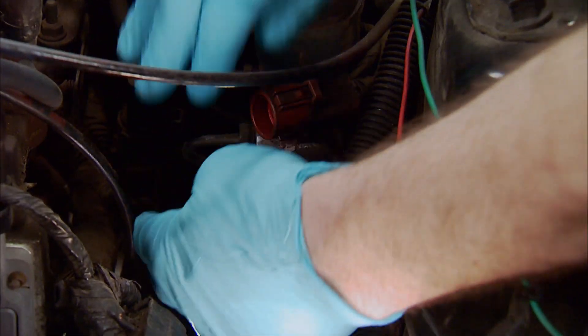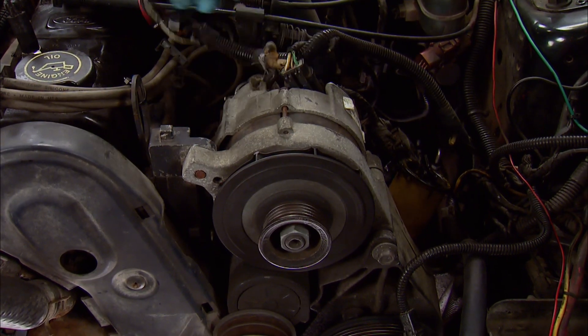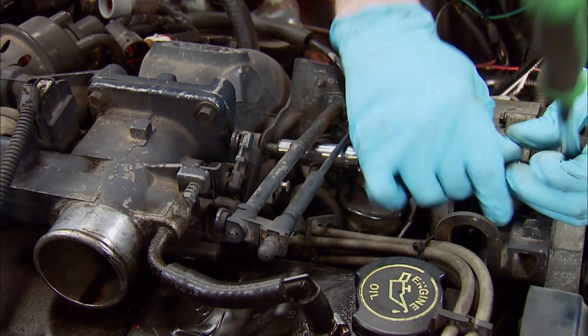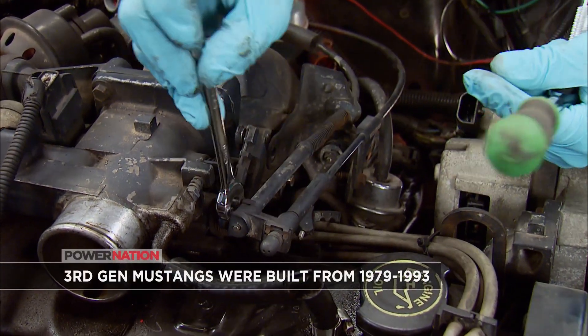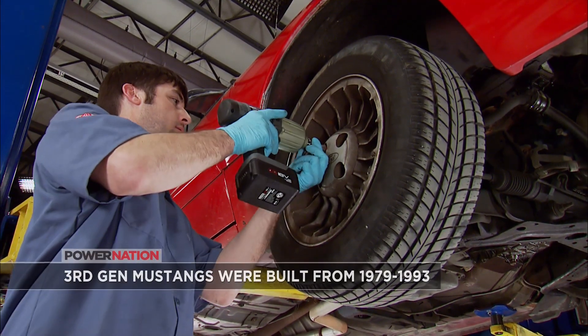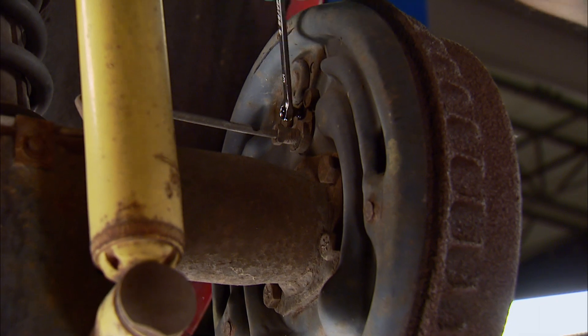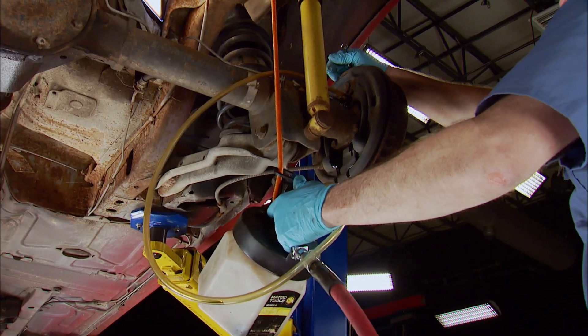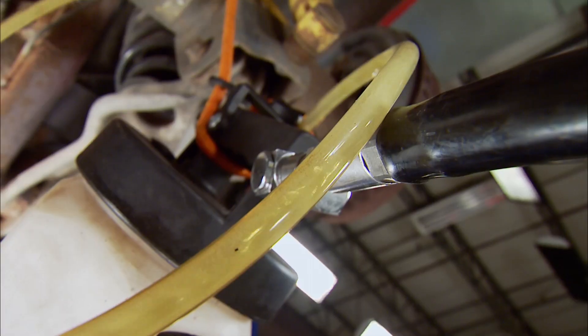Back on top, disconnect the wiring harness from the engine and all of its components. Our new engine's throttle is a drive-by-wire type, so this factory cable can go as well. Brakes are another upgrade we are doing, so this entire system is going away. I like to drain all the fluid at each corner of the car so we don't have lines dripping and making a large mess.